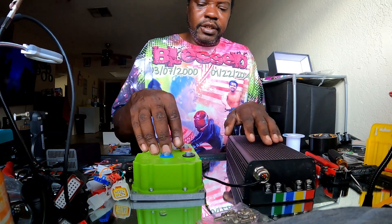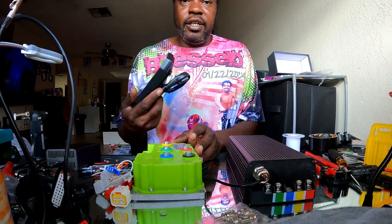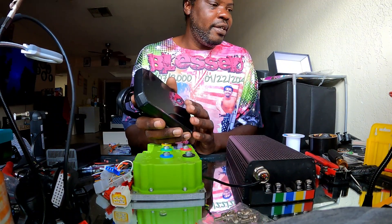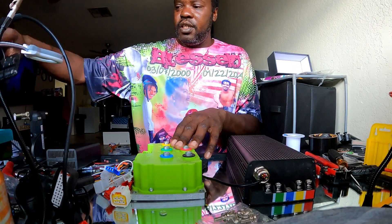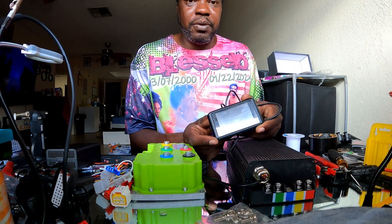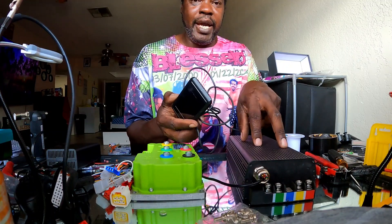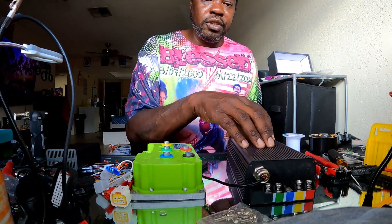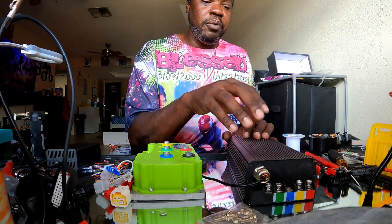So that's a little comparison between these two controllers. I believe the Fardriver is worth it even though you have to do your own wiring and source a display. The Fardriver does support cheaper displays — they have a DKD display and a CT22 display, among others. You just can't use every UKC1, 750c, or SW900 display you find on Amazon. There's a specific communication protocol inside the controller and display that has to match for them to communicate.